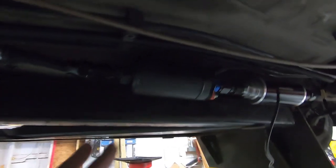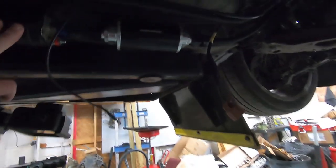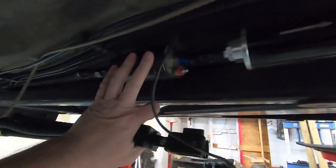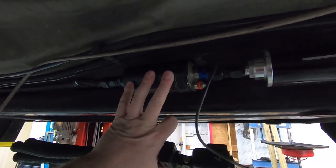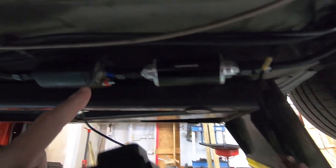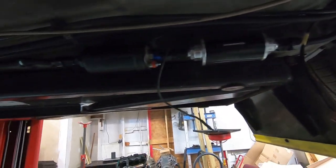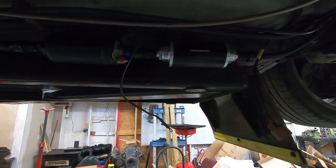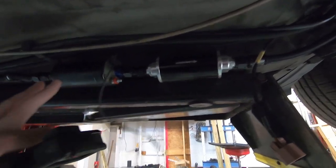And then the main heart of the -8 system is this AEM 380, which I got from our buddy Jimmy. This is actually what comes in like the ECS, East Coast Supercharging Stage 1 fuel kit for a C6 Corvette. It's an external add-on. That's kind of where Mike and I got this idea, because Mike did the same thing on the OG car, except he has a MagnaFuel 750 here instead of this pump. And this pump with the stock Corvette pump, we made like 850-ish horsepower to the tire through a manual. So this is more than sufficient for what I need.